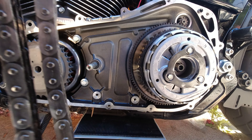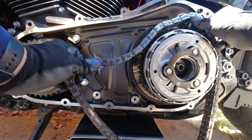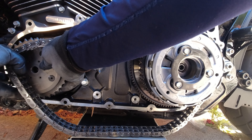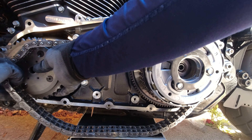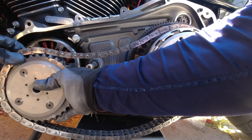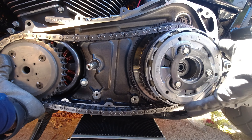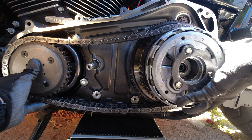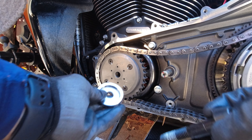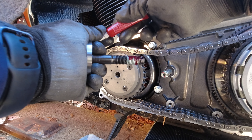You can see the clutch basket is fully inserted — I pull it out slightly. Like I said, this makes it a lot easier when it comes to juggling the comp and clutch basket together during installation because it can be a bit of an issue if you're a one-man show. Everything is fitted properly and going smoothly. The bike is leveled. We need to use red Loctite for the T70 — it is crucial to do this. I just dabbed a little bit on.